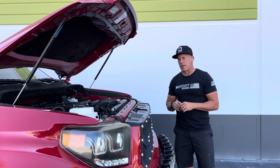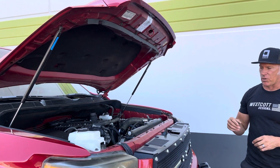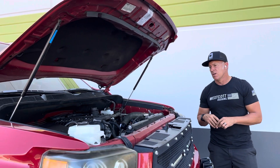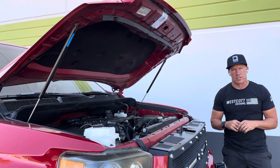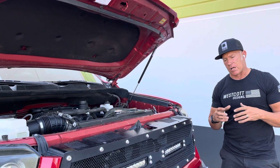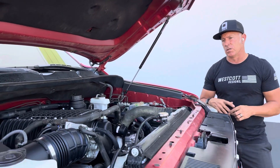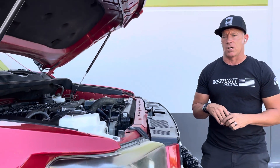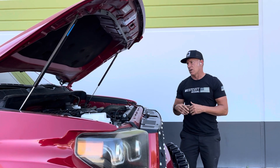One of the things I tell them is full-length or long tube headers, high-flow cats, and full exhaust. They also make a different blower pulley by a company called Z Industries — it's a smaller one in size so it allows a couple more pounds of boost. I usually tell people to start with the larger crank pulley because it has more diameter and allows better belt traction. Going to a smaller blower pulley increases boost pressure and puts more load on the belt, causing it to slip, but Z Industries out of California has a Grip Tech technology that works really well with that.